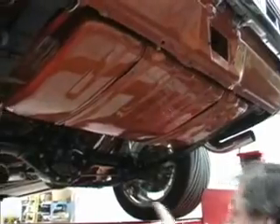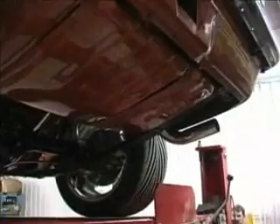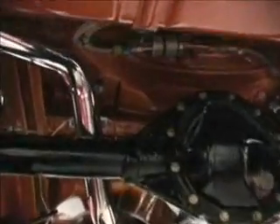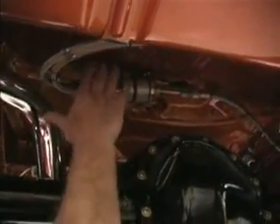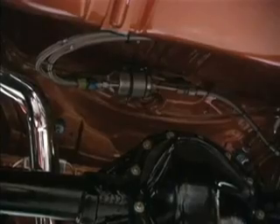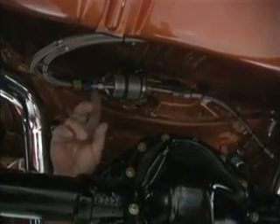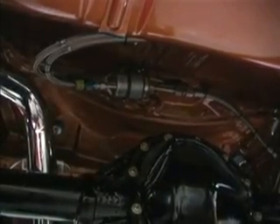The stainless exhaust we did here in our header shop. You can see the fuel filter kit — we mounted it up underneath right above the rear end. Because of the LS2s and LS7s and their fuel rails, we can't do the dual. So the big line is the inlet on the fuel and the small 5/16th line is the return. But with these compression fittings, we get back and use AN6 hose on both. Then it goes into our quick disconnect and TubeTech did our fuel line, coming up and bending it.